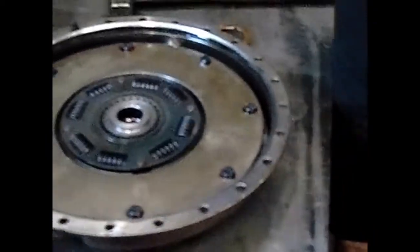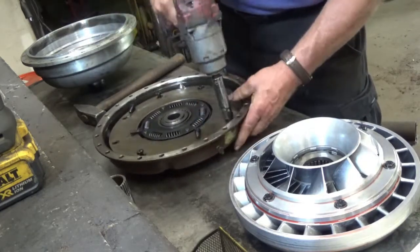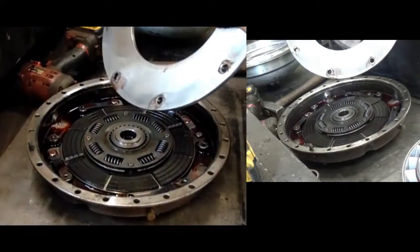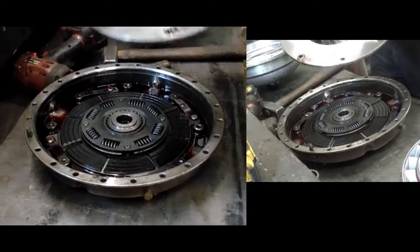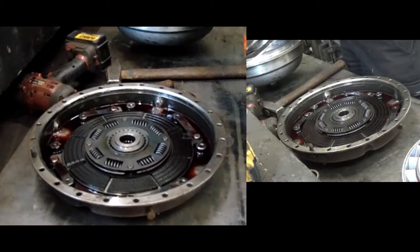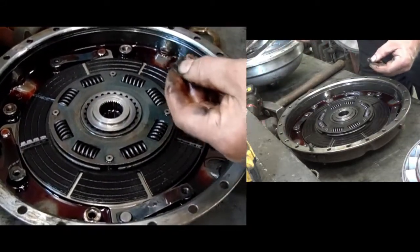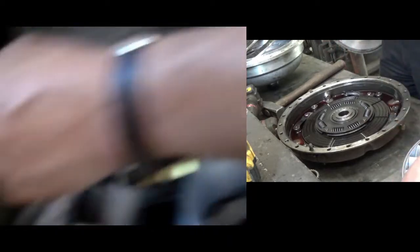This is the reaction plate, which I'll talk about more in just a minute — there's something very important to check about that. There are also four little spacers here, and right now I'm only seeing three, but the fourth one's probably here somewhere. They go on these posts where the other springs are not present. It'll turn up in a minute — definitely want those. Now, this is the infamous direct drive clutch plate. This is the thing that makes all the noise when the transmission gets old.